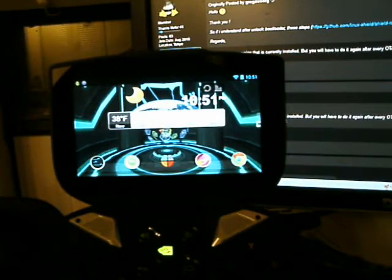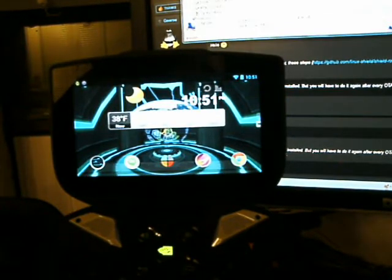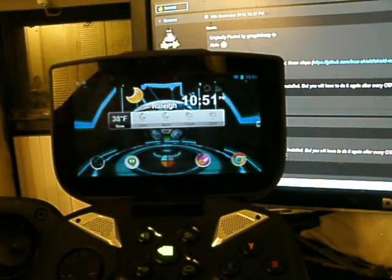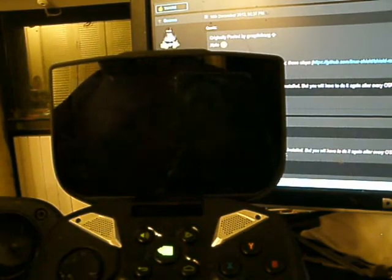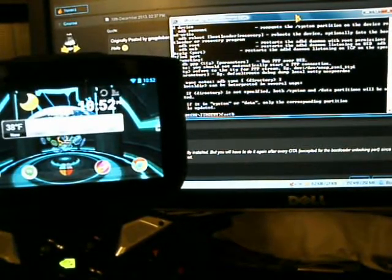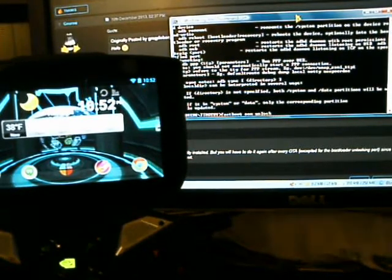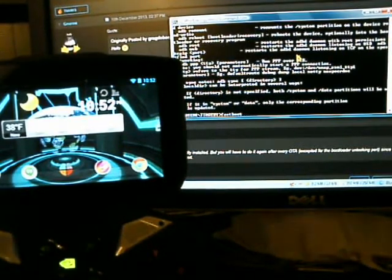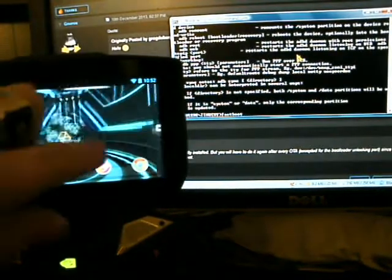Before you go ahead and actually push the new image file in, you need to go ahead and unlock the bootloader. In order to unlock the bootloader, you type in a command that says fastboot OEM unlock. This will tell the Nvidia Shield to unlock its bootloader. Once that bootloader is unlocked, that's when you can tell it to push the rooted image file. Now, by unlocking the bootloader you are going to wipe your device, so please understand that if you have your Shield heavily configured at this point it's going to get wiped. The best thing to do is do this rooting process when the Shield is fairly new.